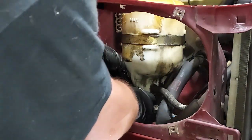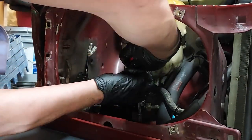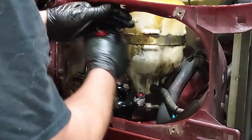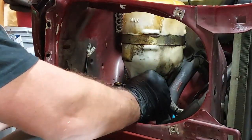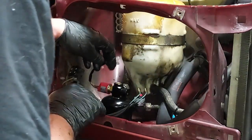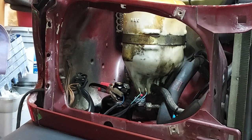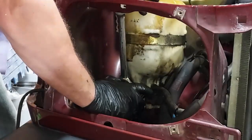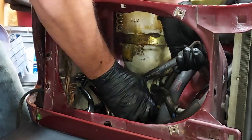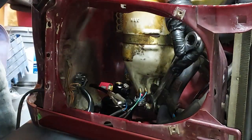Now I'm going to loosely connect our lines. Okay, good. Let's reconnect our switches — low pressure and high pressure. We have our new receiver dryer, new switches, and new seals. I'm going to go ahead and tighten down the fittings — you don't have to go crazy tight; these have o-rings on them, and o-rings do the sealing. Make sure that one's on there.